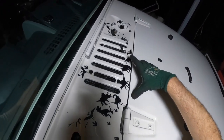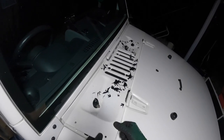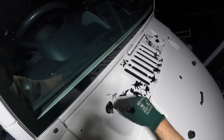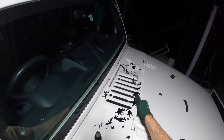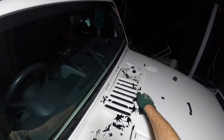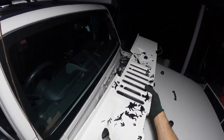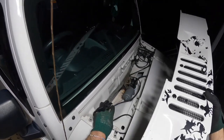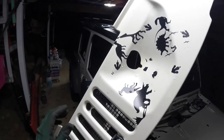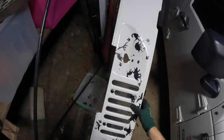Now that the bonnet clips are done, close your bonnet. With those two clips released, all you need to do is lift the cowl part up. I like to slide mine forward to get past the windscreen wiper motors. Just slide it forward, tilting it back a little bit to get away from those components, and you're done.